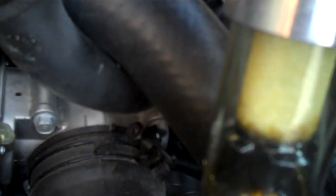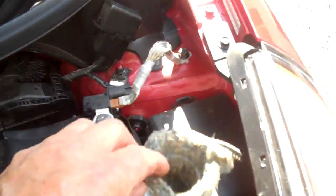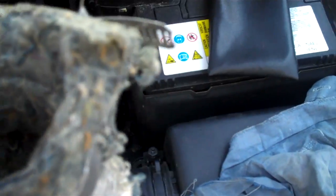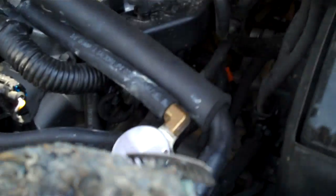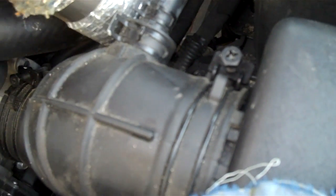This body here is metal, but down here it's a hard impact plastic and the instructions say not to let it get too hot. So what I've done is made a little insulator sleeve to go over the bottom of it, just to protect it from the engine heat, and I have it sitting right like so.